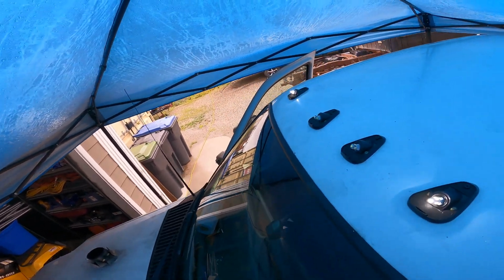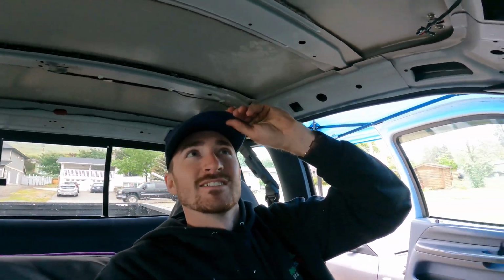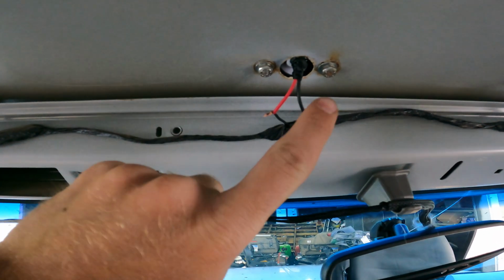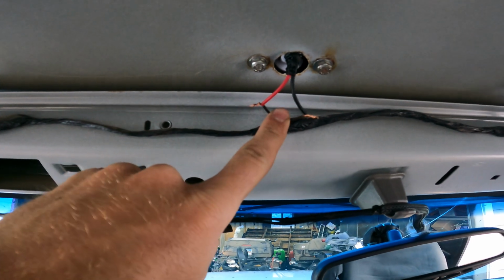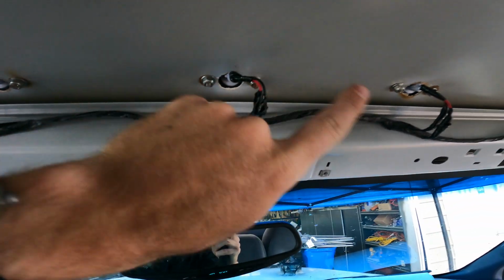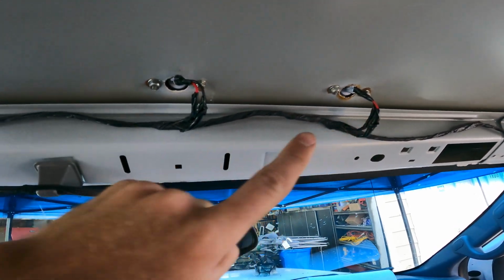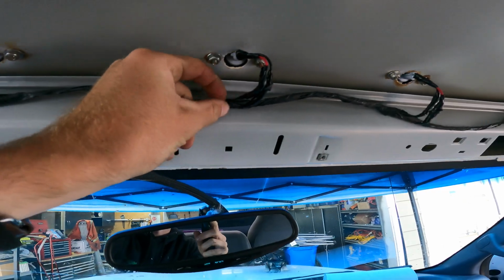we're missing some lights. So now I gotta go back through, and I already pulled this one apart just to test and see if they were backwards, which they are. So I pulled this one apart, I gotta do this one, I gotta do this one, rewire them backwards because the color coding is apparently incorrect.